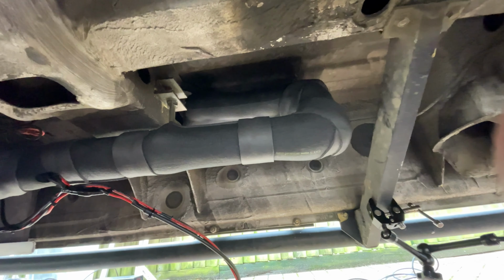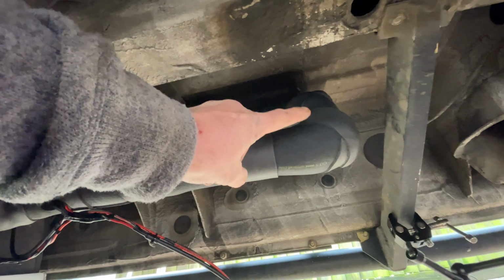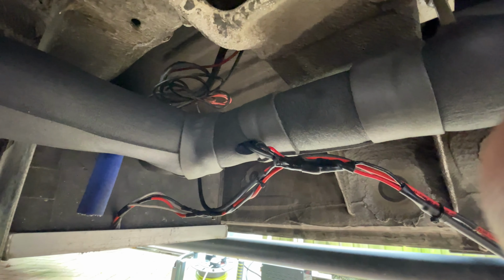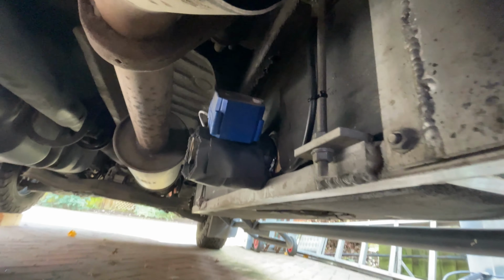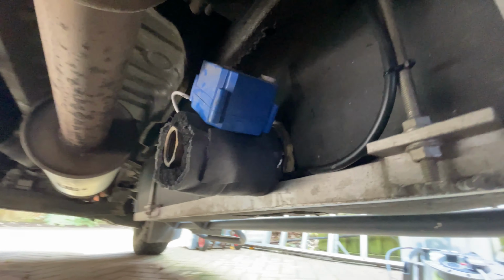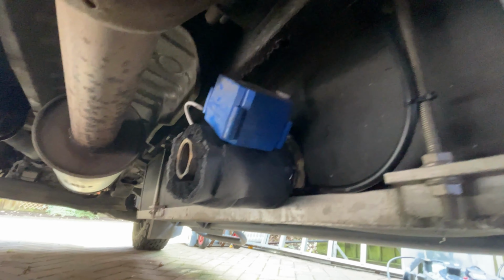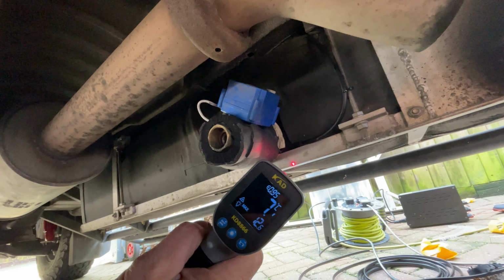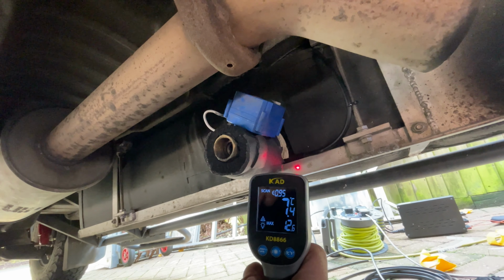Right, so here's the pipe that comes down from the shower at the top there, around through the trap and all insulated, and the heating cables are fitted in there. I've also put an additional length of heating cable around this, which is the electric drain valve for the grey water tank. And if I use this laser thermometer, infrared thermometer, you can see there that the metalwork around the tank is currently at